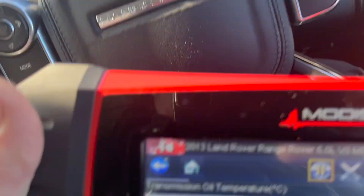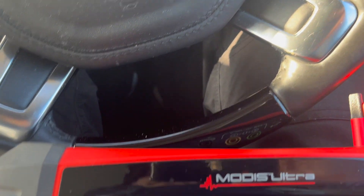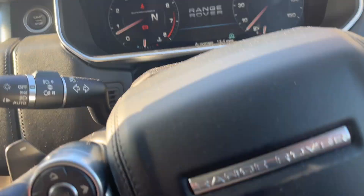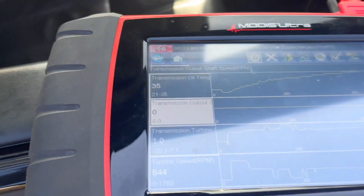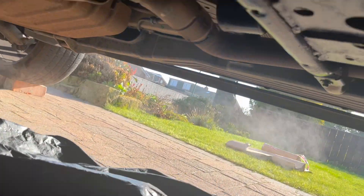The transmission oil is going up to 31 degrees and climbing quite fast. Make sure the handbrake is on. I'm going to fill this up in neutral — make sure the handbrake's on, which it is. Transmission oil is 31 degrees... now it's 35 degrees. The next thing to do is undo the filler plug. I'm using a pump to pump the oil into the gearbox.